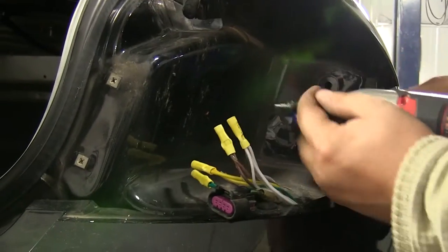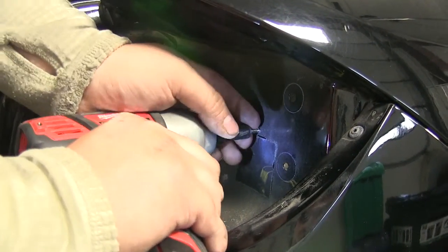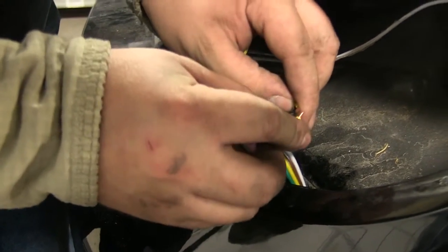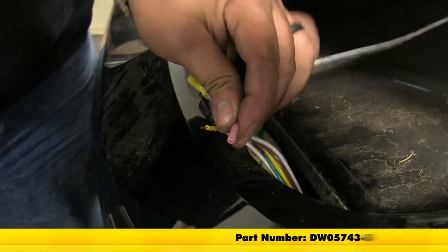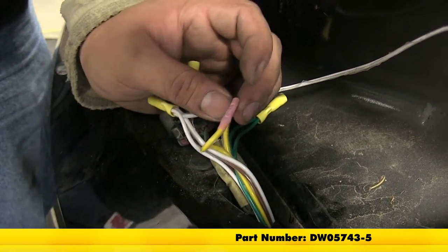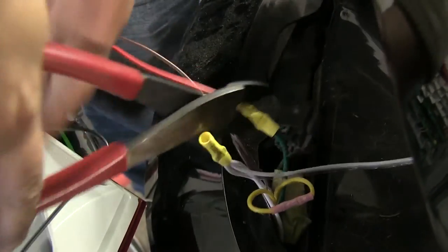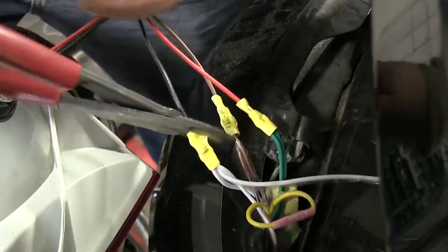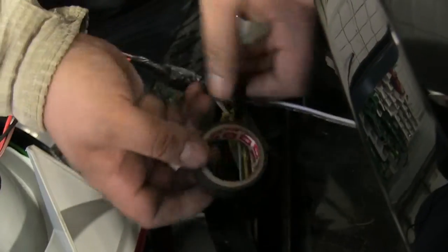This extra connector doesn't come with the kit because you could have left them hooked together with the loop, but because of the extra wire I went ahead and got another one. I'm going to connect our two yellow wires together and crimp it in place — give it a tug and those aren't going anywhere. Now we're ready to hook up the rest: brown goes to our brown. Our red this time will go to our green — give that a tug. And our black is our ground, so that'll go to our white. Now everything's crimped in place and we can tape it up.